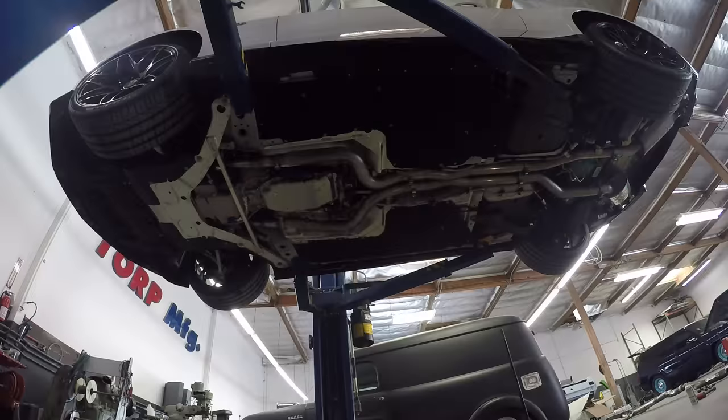But that's really the last part of all of this, is lining everything up, getting it looking good, making sure it's clear all underneath, and then make sure the O2 sensors are on, make sure everything's connected again, the MPP, the AFM valves, so they have power. Because if you start your car up now, it's going to be a Christmas tree without everything installed.